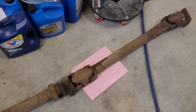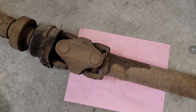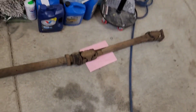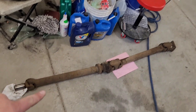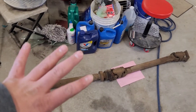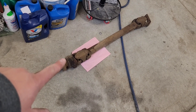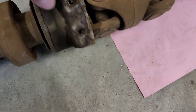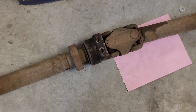I got the monster out. Count them — how many U-joints is that? One, two, three, four — there's the carrier bearing — and five. There is something to be said about lightweight driveshafts because that thing is a ton, probably around 80 pounds. I was surprised once I got it on the floor. We've got a lot of U-joints to deal with, but the carrier bearing right here is the section I think is most of our problem — the rubber is all worn out.